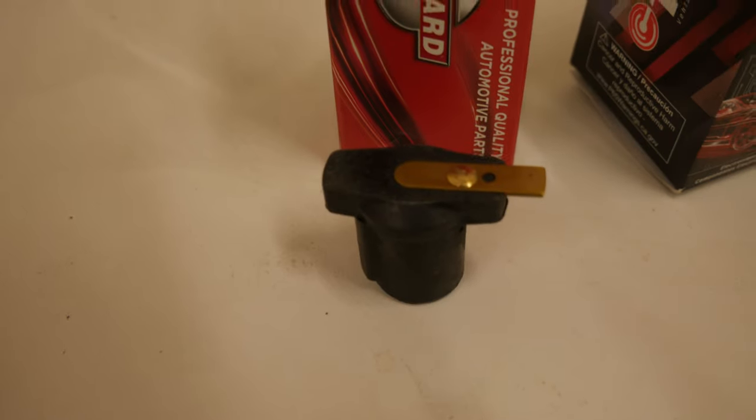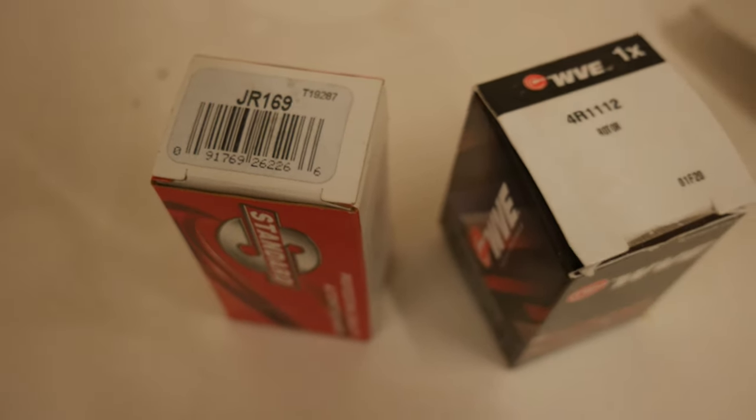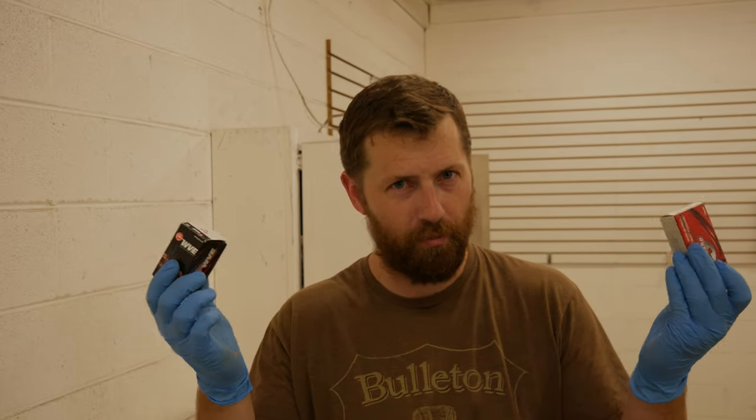For the rotors, I did buy two different part numbers. The original one, JR169, was really tight going on and I thought that might be incorrect, so I bought another one, AR1112. It turns out they appear to be the exact same part even though they cross-reference to different things in the database. They're both kind of a pain to get on, but they do fit and work. They don't fit as loosely as the original, which may actually be a good thing — they're supposed to fit really tight.